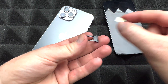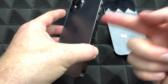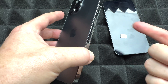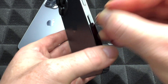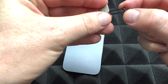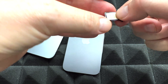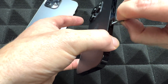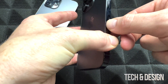We're going to transfer the SIM card to the new phone. Some people say your iPhone should be off for this — I've never turned mine off and never seen a problem, but if you want to be cautious, turn it off. It's really easy: just take out the tray, put in the nano SIM card from your old phone. You can get a new SIM card if you want, but your phone number can stay the same. Then just press the tray back in.